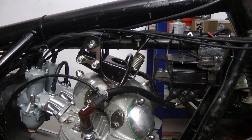I have prepared all the electrics ready for fitting the Trispark system. So the ignition switch, when you turn it on, powers the motorcycle, and it's a 4-position switch, brand new, and arrived faulty, would you believe? So in the parking position, where just the side light should be on and you can take the key out, that doesn't work. Well, it's very intermittent. However, the next position, when you also take the key out, is off.